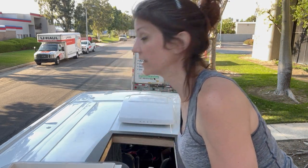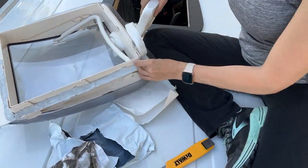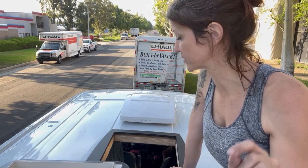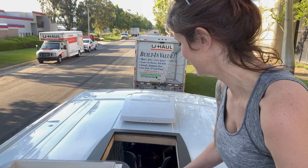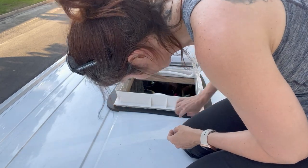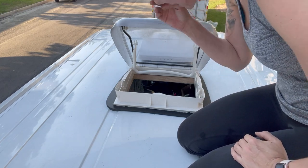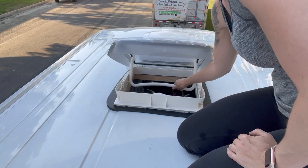I'm now ready to actually install this thing. I'm going to apply the butyl tape all around the edges first, then just stick it on — and that'll be it for up here until I'm ready to seal it. I won't apply the lap sealant until I'm also finished installing the vent so I can do it all at once. I got it seated on here — nothing special, I literally just set it down. It looks raised up ever so slightly because of the butyl tape, which hopefully will be fixed when I clamp it down with the bottom mounting piece. I'll also be sealing all around these edges to make sure I don't have any leaks.